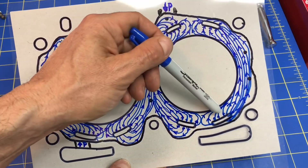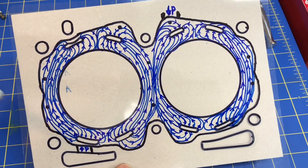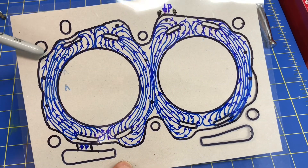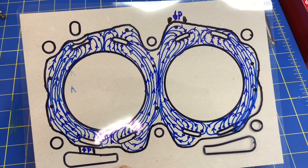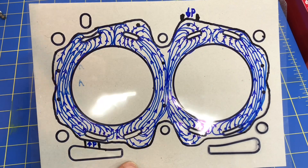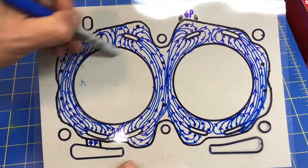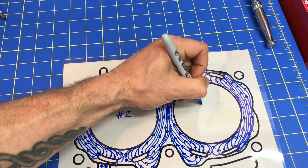This basically shows how coolant enters through the lower kidney slots into the head and makes its way through preferential flow paths based on pressure differentials. Each point where coolant enters wants to exit where it can reach the lowest pressure. This is an even, symmetrical flow field — but only if we have even pressures coming in at the bottom and even pressure exiting at the top. That's not actually what's taking place. Over here is cylinder number two and over here is cylinder number four.